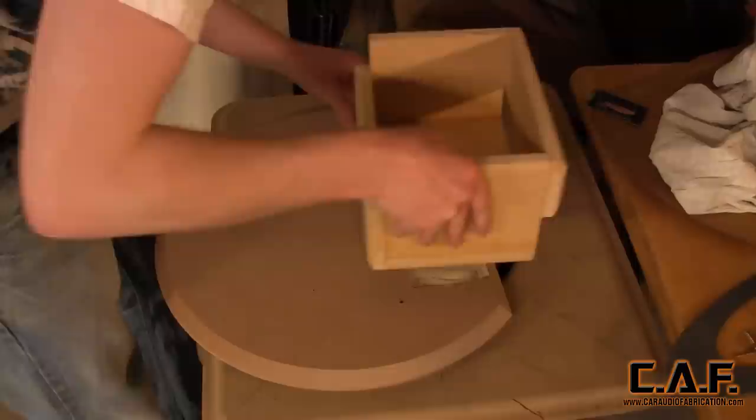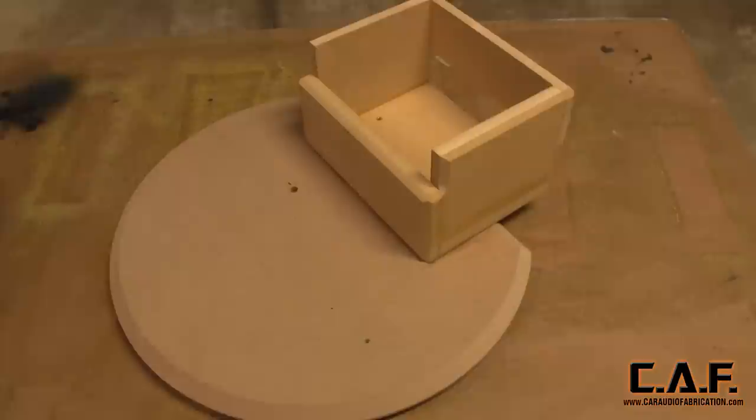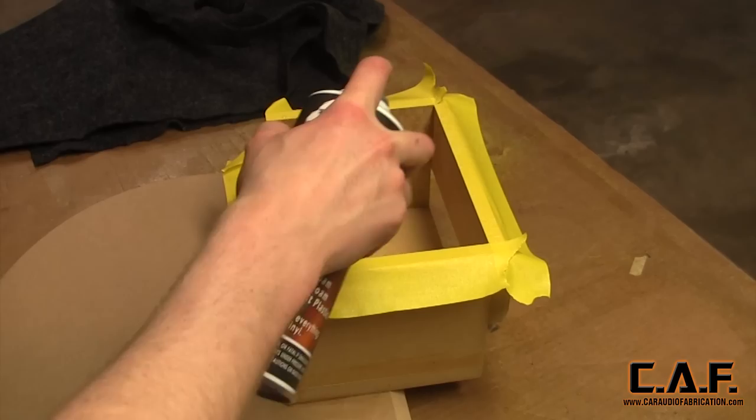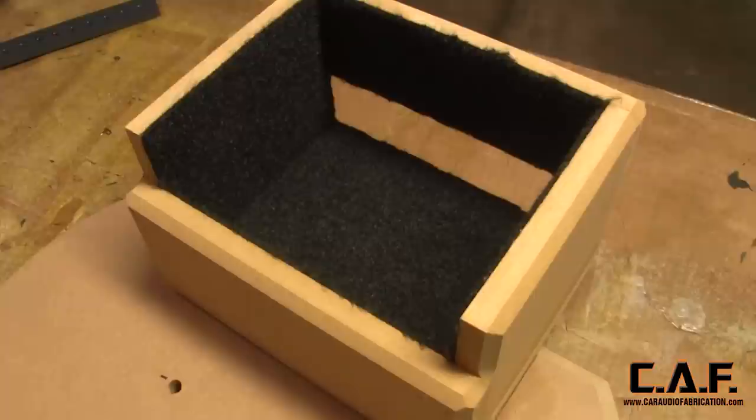I removed the assembly from the vehicle and used plenty of wood glue along with wood screws to secure the battery box into position. This is just one of many ways you could tackle this build, but I like that everything is based off using an existing fastener. The battery rack assembly is looking really good, so now it's time for paint and some carpet. Since this is just a small carpet job, I'm using some spray glue. What I'm actually doing here is lining the inside of the battery box so that the battery doesn't get scratched by the wood, which will also help to prevent some vibration transfer into the battery.